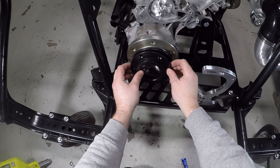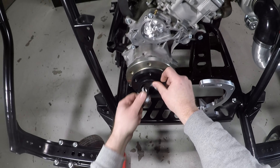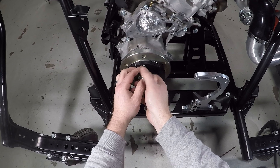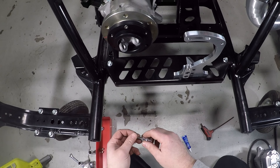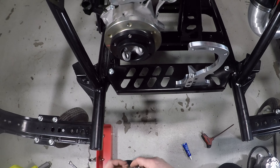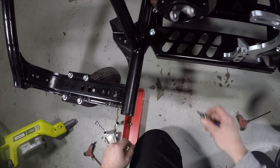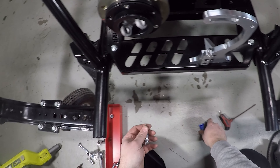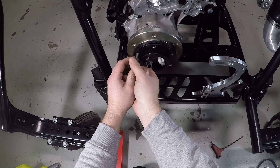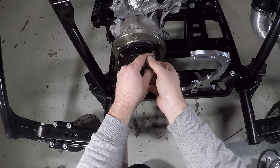The second portion of our pulley assembly is the actual pulley. We made this as small as possible for a reason — if we could have made it any smaller, we would have. We could have easily saved money and made installation easier by making it a one-piece pulley, but in our opinion that's just not the right way to do it. Hand-tighten these, get them all started first, because this pulley-to-flange is a very precise machine fit and you want to make sure it's not sitting crooked. If any of these fasteners give you trouble, it might not be perfectly aligned, so double-check all that.